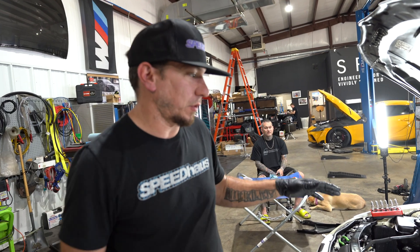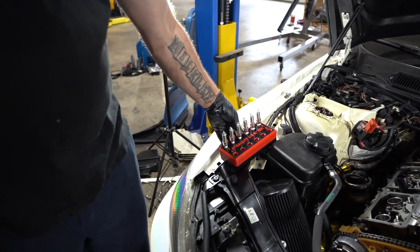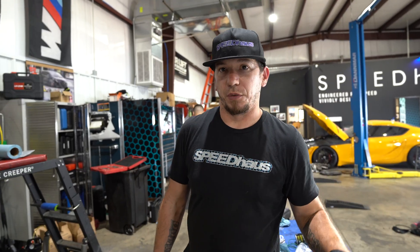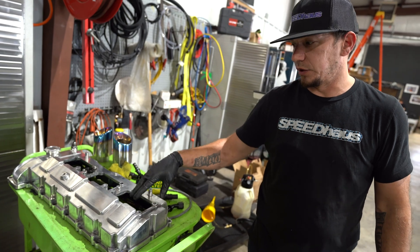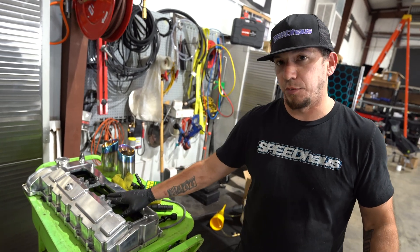Now we're done officially plugging the ports. The valve cover is ready to go back on; I've got the intake and charge pipe on. I'm going to turn that part back over to Gage. He also 3D printed a really nice mount for the plugs — they're fully magnetic, hold both the new plugs and the old plugs, and they are for sale — we'll drop the link in the description. As for the cover, we went with the Vargas full billet version, which has no PCV, so we had to switch to external — which is why we plugged the head ports. We'll run our own check valves for the catch can system.